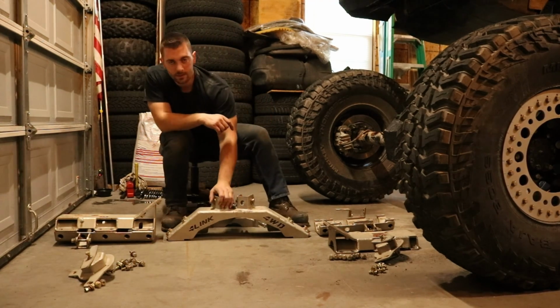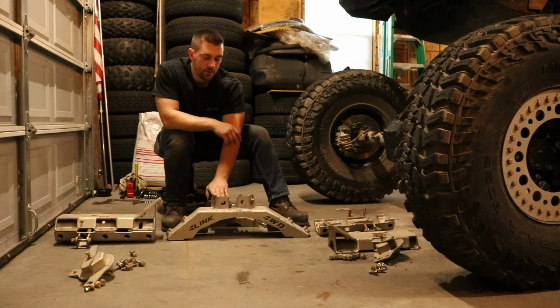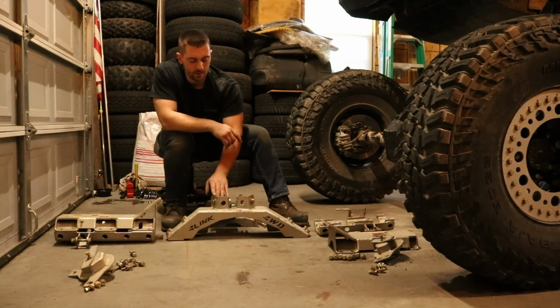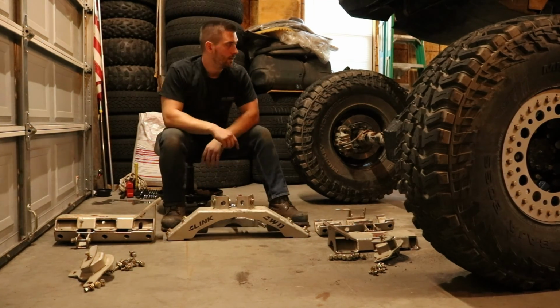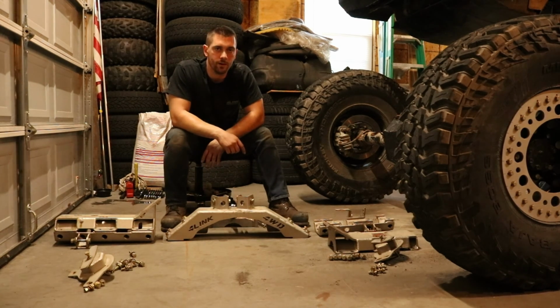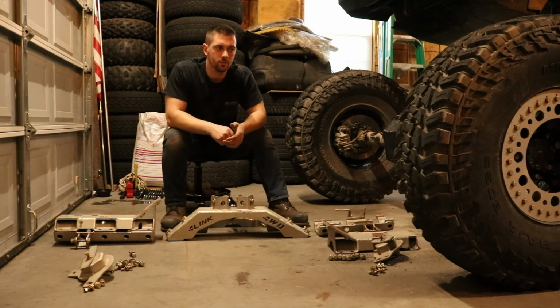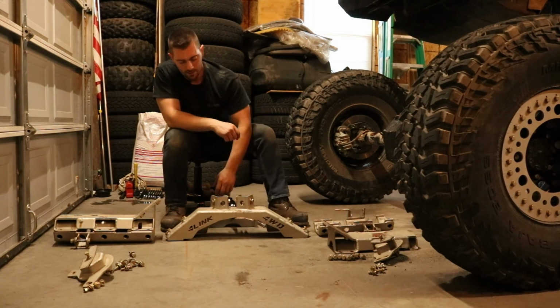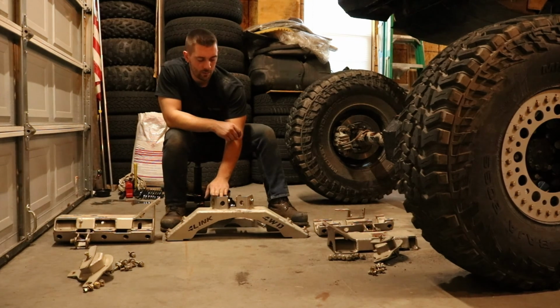And we also have the upper control arm mounts here. So when you go to order this online, you can choose between the 2-inch mounting width, which is what I use. Probably more commonly is going to be the 2 5/8 inch mounting width for your bigger Heim joints or Johnny joints. So you have that option to pick which one you want.